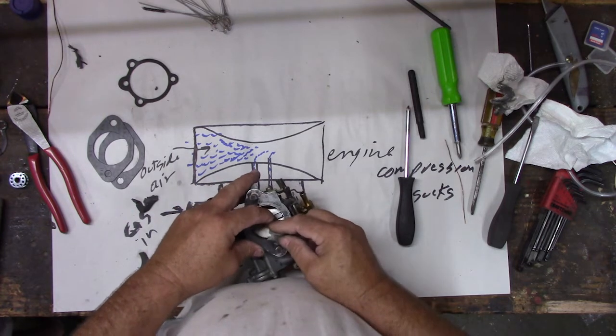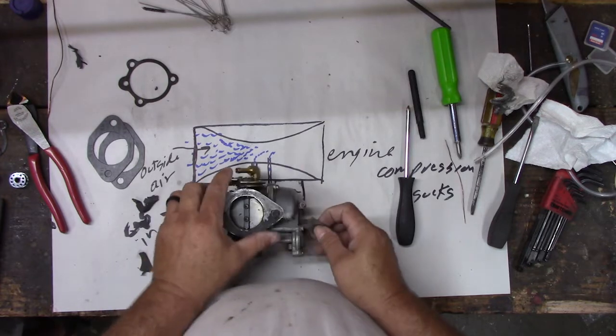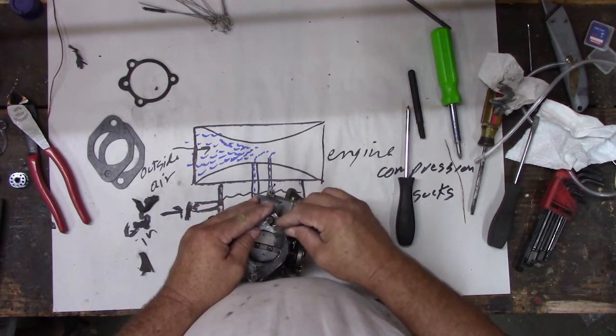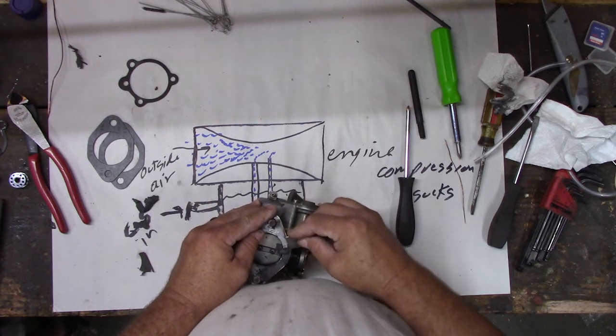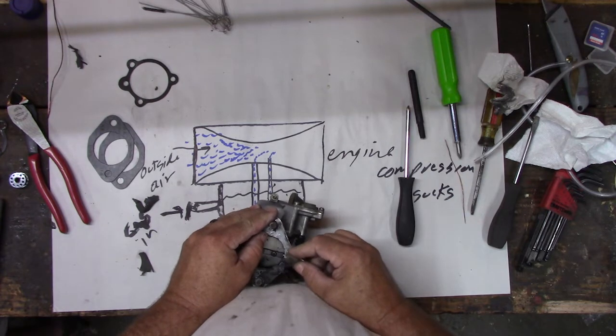And I think we changed the exhaust on this bike too. That might help it a lot. Get rid of those drag pipes, put a real muffler on it, get some back pressure, it might help a bunch. Could be there's something still wrong with the engine too. Could be just getting oil fouled or something. Maybe it's got a leak in the head gasket or something.